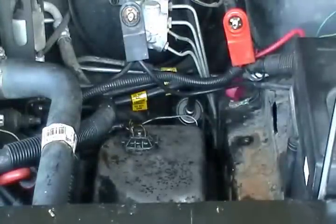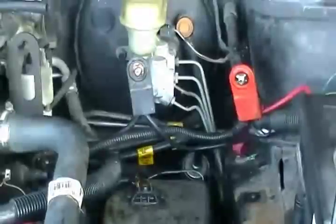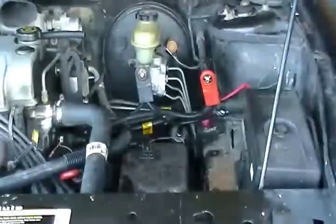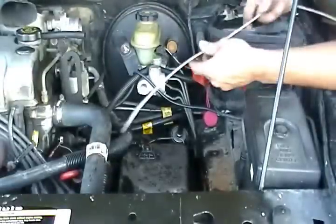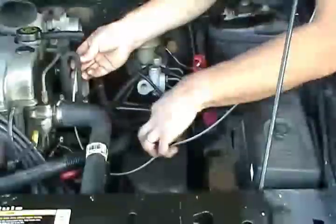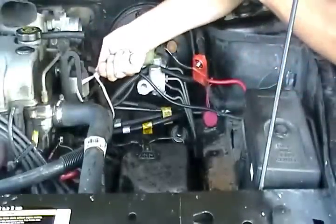Now, all those electrical wires want to be put to the side, because you're going to need to take that electrical connector and the pan off. What I use is what's called a zip strip — you can get them in any automotive store. Battery terminals, as you can see, I'm just draping them over the master cylinder to get them out of the way. If you watch when I pull tension on it, it's going to pull those electrical lines and the wiring harnesses out of the way so I can get to the pan. Which is perfect.